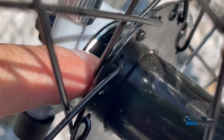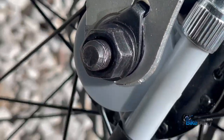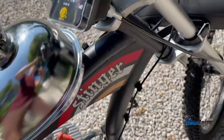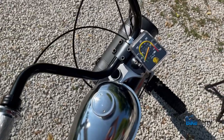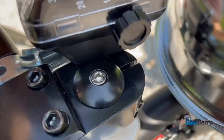Look at the back side and make sure everything stayed together — there's a circular ring clip that holds all of the parts together. Once you have the little tab bent over, it'll stay. I haven't really had any trouble with these; I've had one on the black bike for a long time. As far as placement on the handlebars, you're really at the limit of this cable, and this bike — as soon as you stop — the handlebars go wham. So you want to make sure it's not going to interfere and get knocked off by the gas tank. Mine's going to rub on it a little bit, but I'll work on making sure it stays on that side when parking so I'm not wrecking the cable or the mount. It sits on the ledge of the headset, which helps keep it in place.